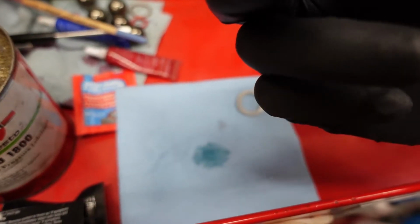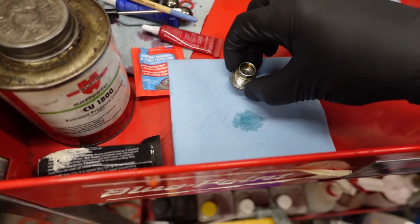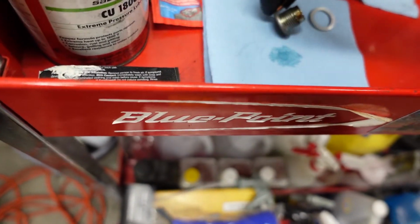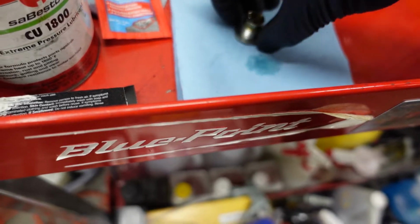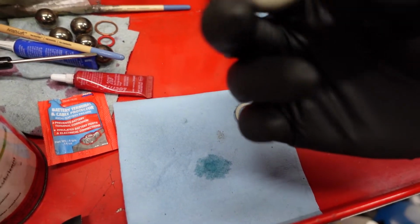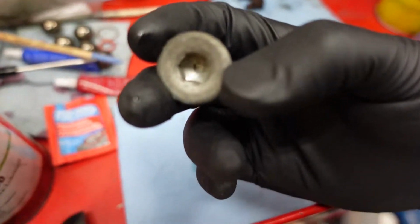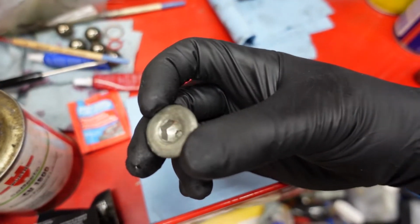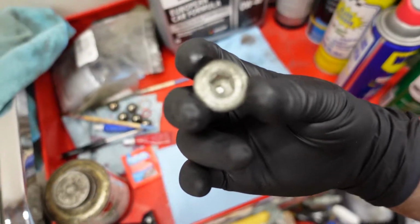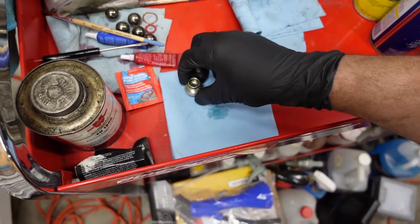Depending on what you read, some people will say to actually replace the whole plug. But as you can see, it's steel and not aluminum, so in my opinion, you can be fine with just replacing the washer. Because really, the aluminum plugs are the ones you need to replace, because the edges of where the hex socket goes, you'll start to see them wear down and start stripping, but with steel, that doesn't really happen. It's with the aluminums you have to worry about.